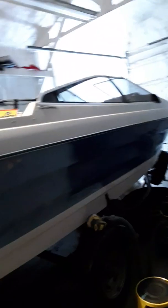Video number 73, mental note. What I am learning — I've seen it in videos and it's coming truer today than before — is that when you have a crack like a spider web crack, like I had on the other side, what happens is you go to sand out the crack and what pops up is these pits.